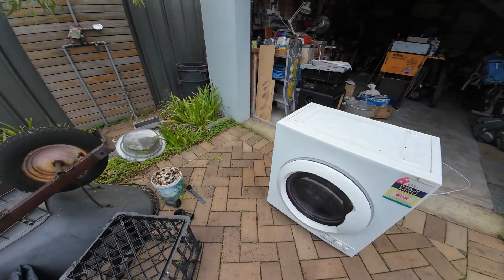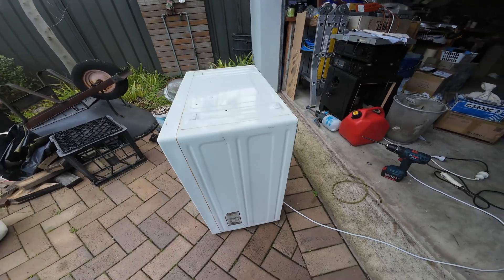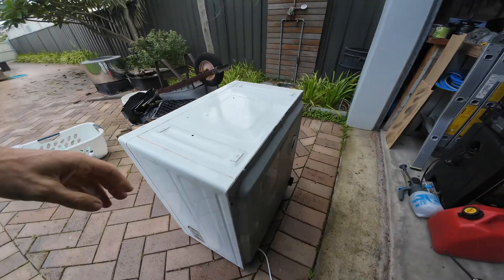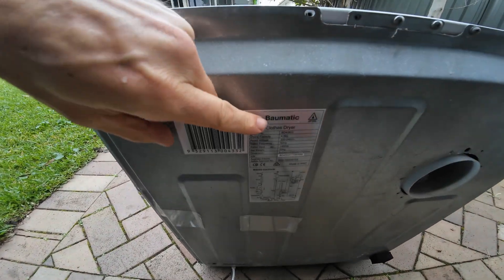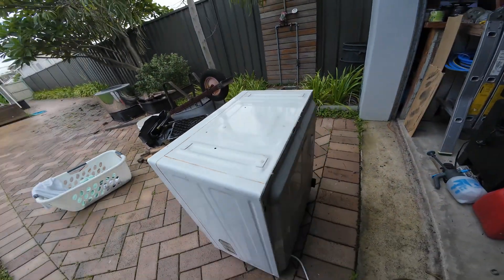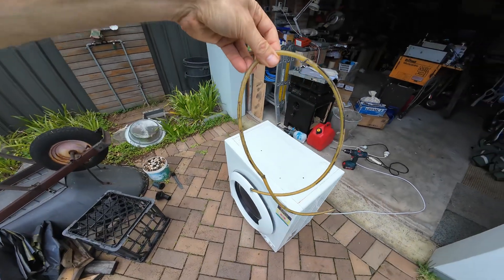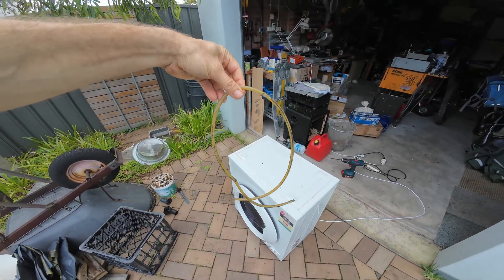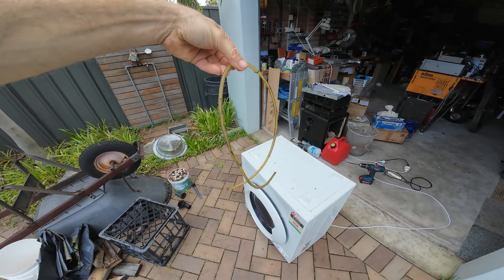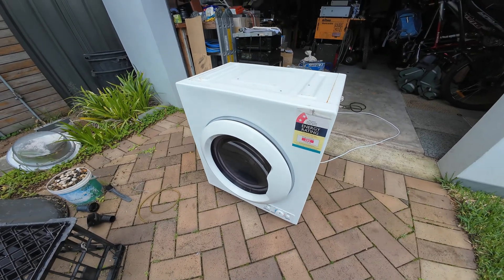This is a Bomatic BD45kg, which tells you automatically it's a four and a half kg dryer. It's a little bit unusual in that it's really thin. They normally come out to about here. The model number on the back is BD45kg, and this one wasn't working because the fan belt was stuffed. These are 270mm diameter - any generic fan belt that's 270mm diameter will do. You don't need to buy a brand-specific one, so that's a little tip for you.